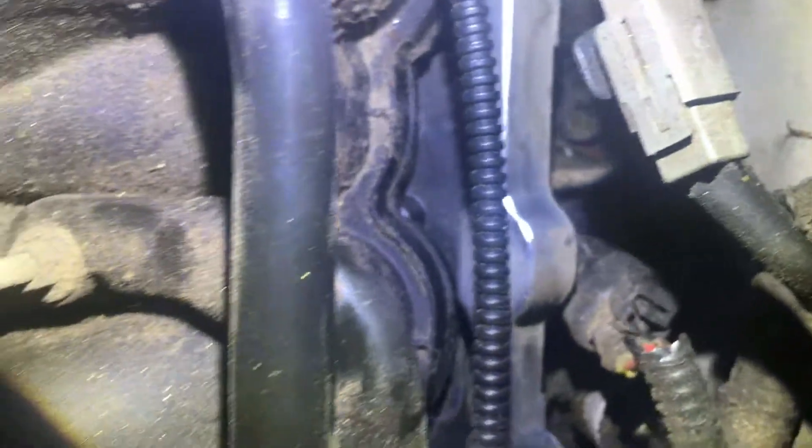So those are leaking also. This I fixed — this is your other common one, where the o-ring just crushes and becomes hard as hell. You take that off, you can just reach in there with your hand, take off this screw and that other screw — I think it's torque 25 or 27 — pull it out and there's an o-ring on it. And that goes bad also.